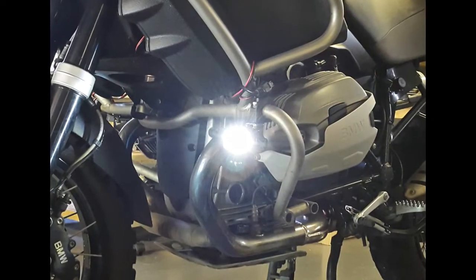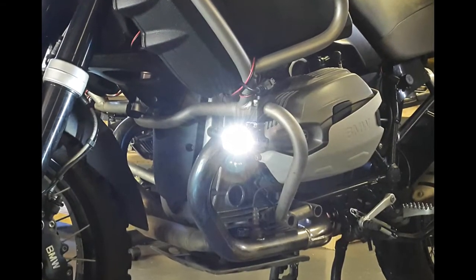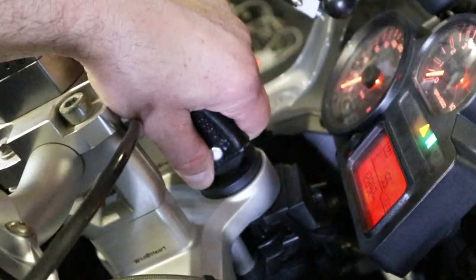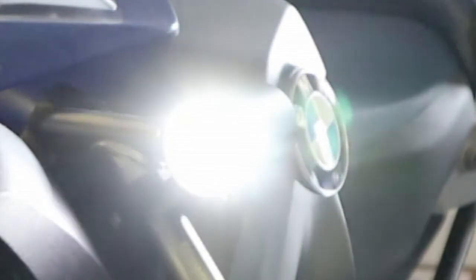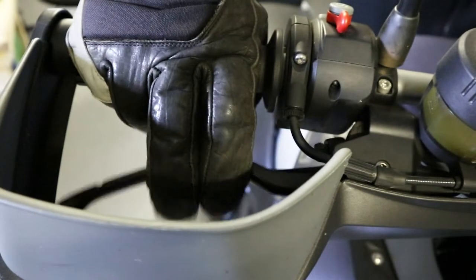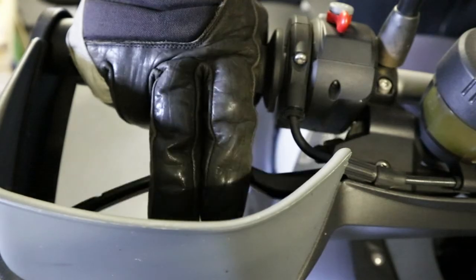When a power output channel is assigned to one or more than one accessory spotlight, the relevant channel or channels will be powered whenever the ignition switch is on. You can also use the ezCAN software to set the spotlight brightness limits for both day and night. When a power output channel is assigned to an auxiliary brake light, the channel can only be activated by using the brake levers.